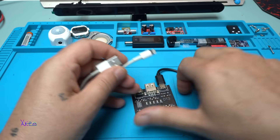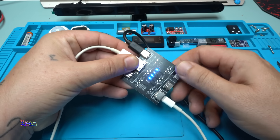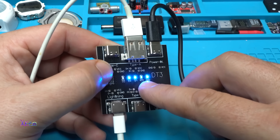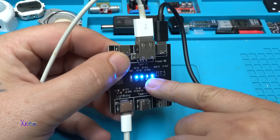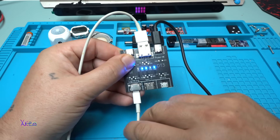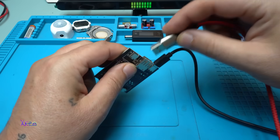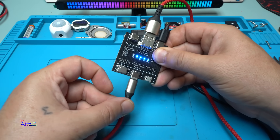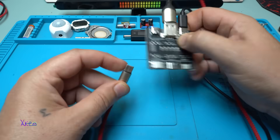I found a Lightning cable. I'll plug it in here where it says Lightning connector. Take a look — the third LED, which is power supply positive, is not lighting up very well. Let's try the other way — it's still not at full brightness like the others. That means this cable is not good. Let's check — yes, when you move the connector one of the LEDs is flashing. The ground connector is bad.